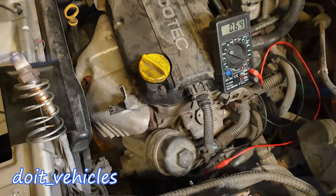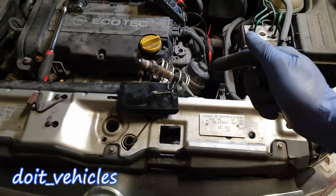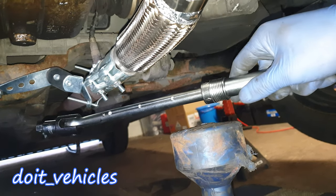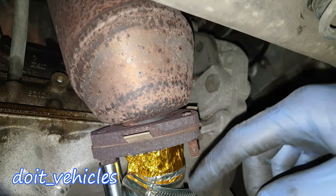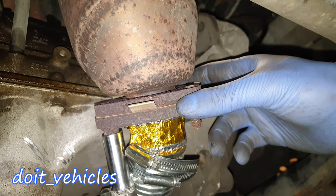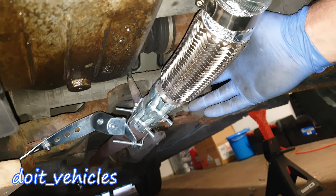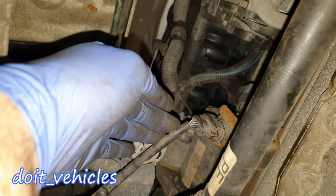You can see you get the same signal on the voltmeter as on the scan tool. Now I will leave this sensor to cool down and go under the car to remove the second sensor. In most situations you will have to remove the exhaust pipe in order to fit your breaker bar on the oxygen sensor and twist it out. You will need to undo the three 12mm nuts arranged in a triangle. Remove whatever it takes to lower the exhaust pipe, and make sure you disconnect the oxygen sensor — the connector is similar to sensor 1.